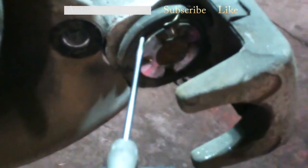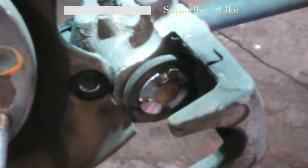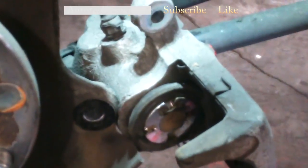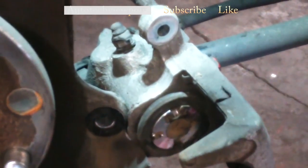If this rubber starts to twist, I'd recommend getting a small screwdriver and working it along the edge a little bit. The piston is collapsed now, but there's a little ridge in the piston that it sits in — you can take your screwdriver and work it around. You really don't want this twisting and binding. If this rubber boot seems mostly missing or has lots of tears in it, you should consider replacing it, because dirt can get in there and cause the piston to seize or leak.